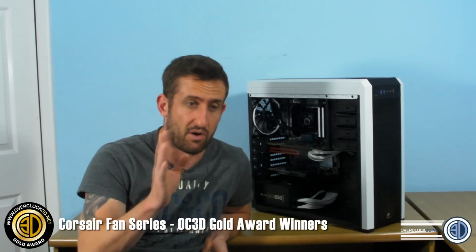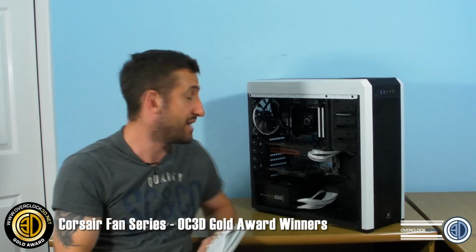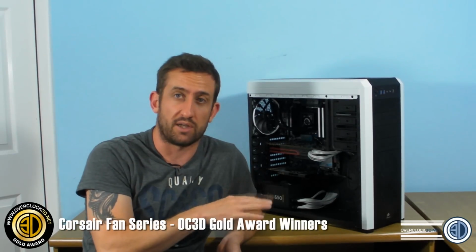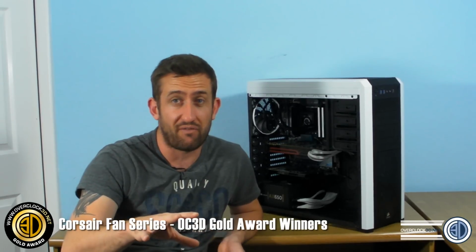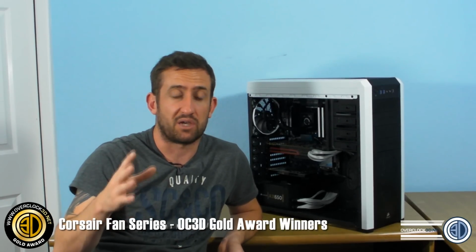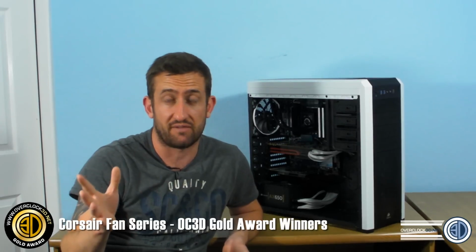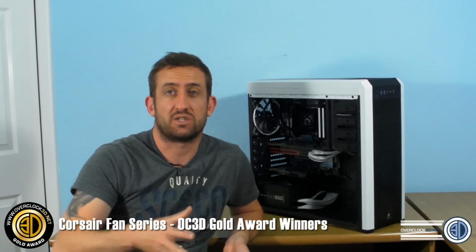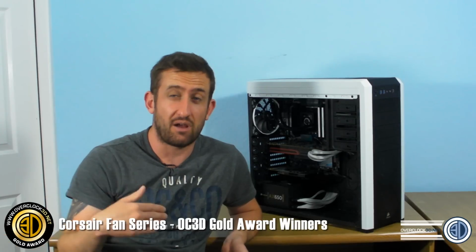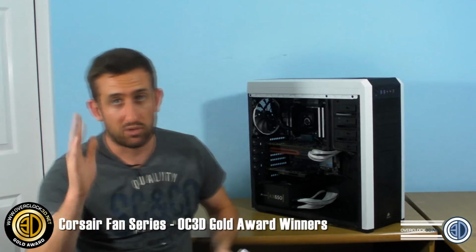But at the same time, not only could I not really find anything wrong with them, they've ended up completely changing my mind. So I'll tell you the award, Gold Award, without a second thought in my mind, and I'll explain to you why. We'll talk about the SP120s, starting with the static pressure 120s. I've used the quiet ones. One thing I will say right from the beginning is if you want to use the performance models, fine. They will drop your temperatures a little bit more, but the trade-off will be a lot more noise, because basically they're the same fans, they just spin a lot faster. So by spinning faster, you're going to create more noise. If you're not worried about noise, then buy those ones. If you're like me and you like your quiet, then you want to buy these ones. But we'll talk about temps.